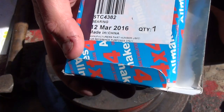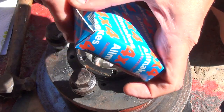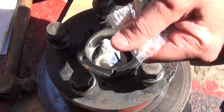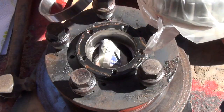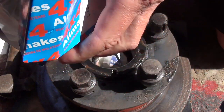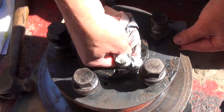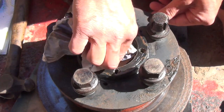Next up, new bearings. These are an 'All Makes' brand — I didn't know when I ordered them; I would usually go with Timken bearings. These are a Chinese all-makes brand so I'm not happy about it, but I've got them so I've got to use them. It's important to keep everything clean from now on — you don't want any grit getting in there. Also keep the shell and the bearing married up together because you'll have a shell and bearing for each side.